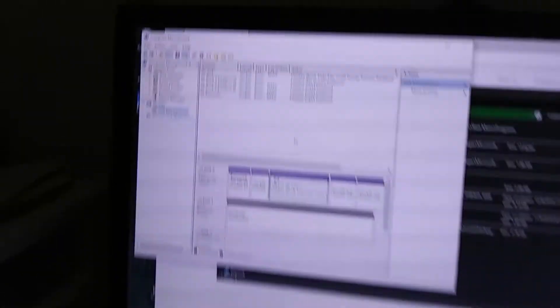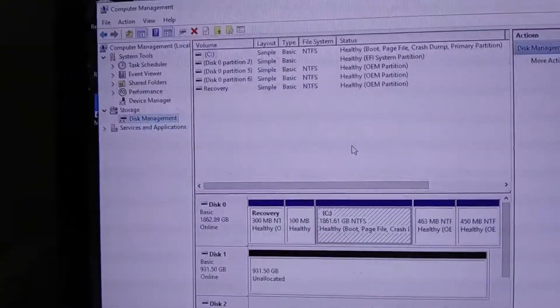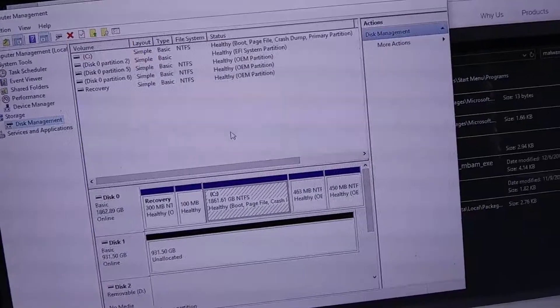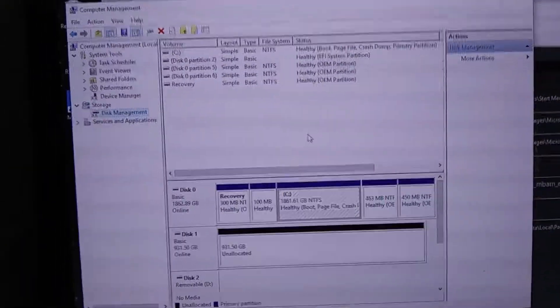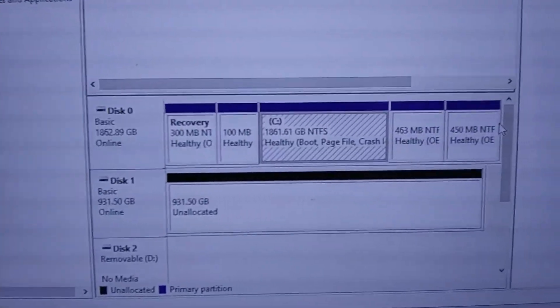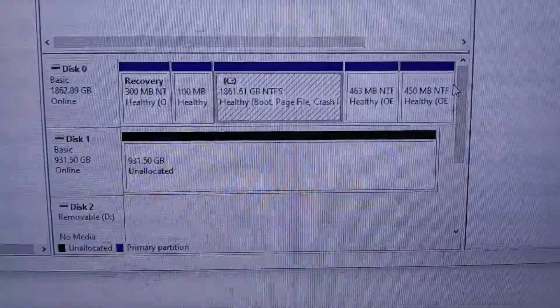I'm going through a tutorial to add a drive letter to the SSD. You right-click This PC in File Explorer and go to Manage. A box will pop up asking you to initialize the disk for the first time — you can just choose the default GPT option and click OK. This is the menu you want after you install it. Go to Computer Management and you'll see disk one listed as almost one terabyte, unallocated — that's the SSD.